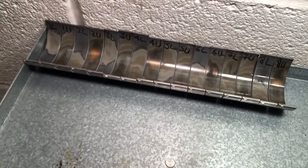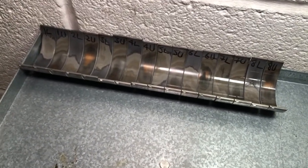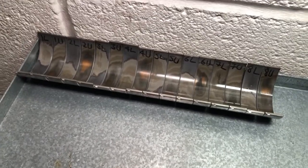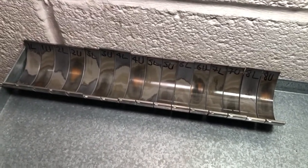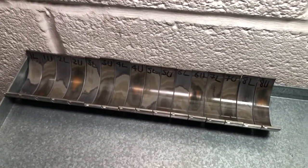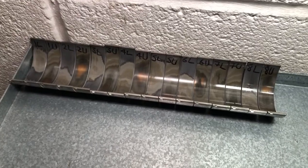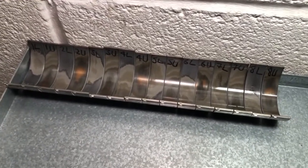Tolerance stack is where the crankshaft journal is at its maximum permissible value and the conrod and bearing are at their minimum — the tightest clearance — so you end up with very tight sections of the engine that are still within tolerance but are just unlucky because they're worse off than other engines. Some of it might be warm-up cycles and some might be driving style, but for a fastidious owner like this I think it's more to do with a slightly poor design. These bearings probably should have lasted the lifetime of the car but they clearly can't, and they literally need to be considered a consumable — at least once, possibly twice, in the car's lifetime.